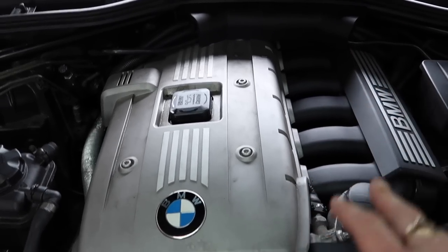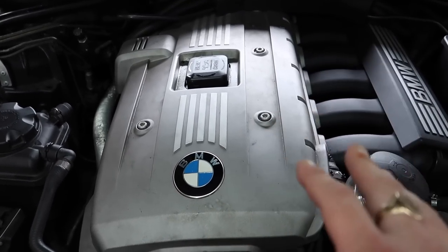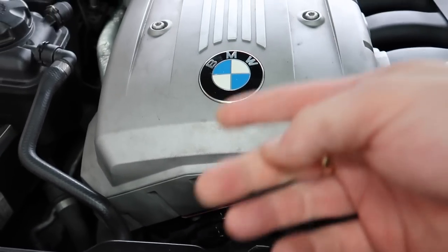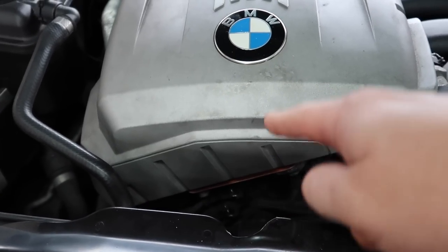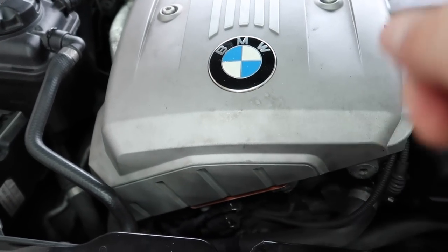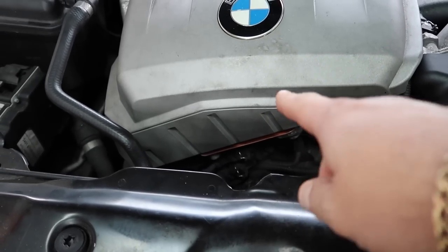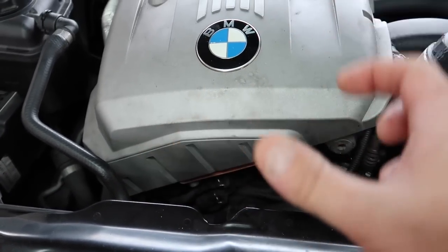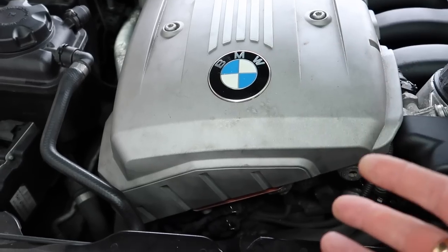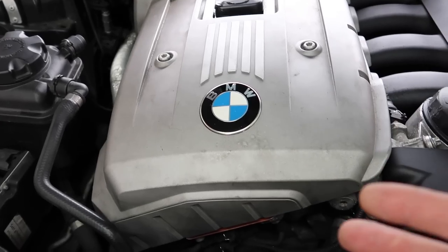Anyone who's worked in a garage and been removing bolts all their life should know that. Many YouTubers won't use a torque wrench, and the ones that are using one are guiding you the wrong way. 10 Newton meters is about hand-tight. Anyone who says they need to be tightened with a torque wrench — it's purely because they are using cheap VANOS solenoids. The seal can't get in to the housing where the solenoid is meant to go, so they try to torque them to keep them in there. Do not believe that you have to torque them.